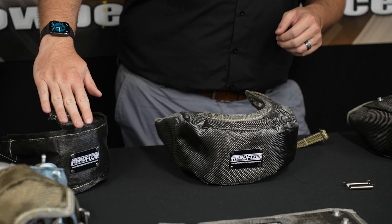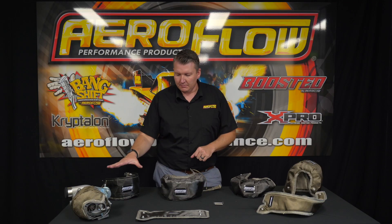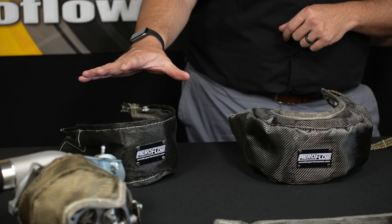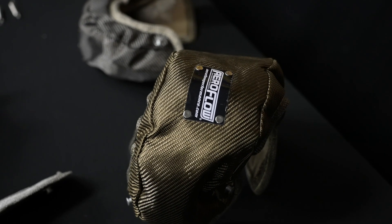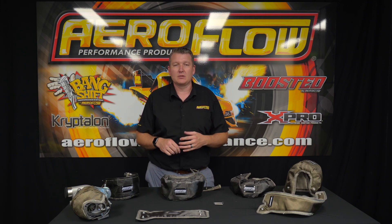And then there's one in the middle, plus personal preference for the look you like. As you can see here, we have the black standard finish, the carbon finish, and the titanium finish. All three have the same glass fibre material on the inside, which is resistant to 1370 degrees Celsius — about 2500 degrees Fahrenheit. The external rating on the black standard is 600°C, the carbon is 1000°C, and the titanium is 1370°C or 2500°F. So the titanium has the highest heat rating both internally and externally. If you really need to manage engine bay temperatures or have components close to the turbo, definitely go straight to the titanium — it's a little more expensive, but it'll save you money and give you a better result.